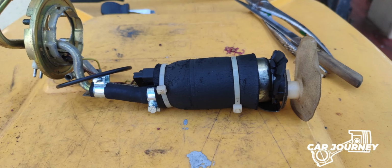So after all that, I also went to replace the fuel lines of the lift pump, or the in-tank pump, and that is also with fuel line clamps. I checked the cabling on that as well, because a lot of the time people think the fuel pump could go bad or anything like that, but in essence it's just the wires wiggling themselves loose over time.